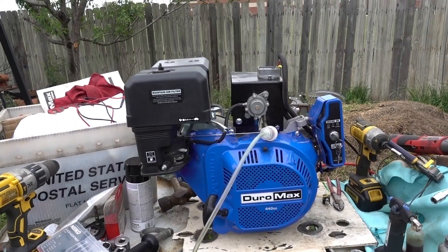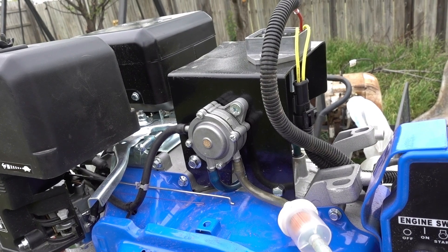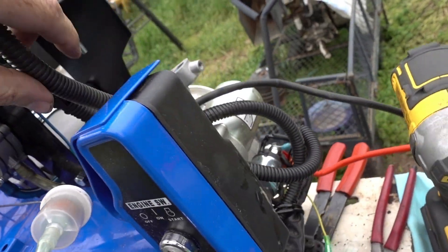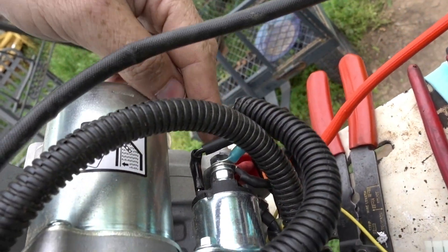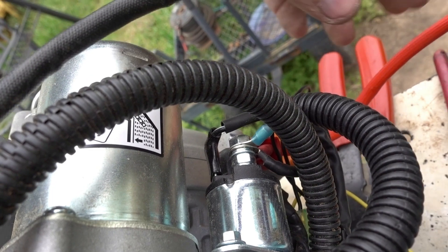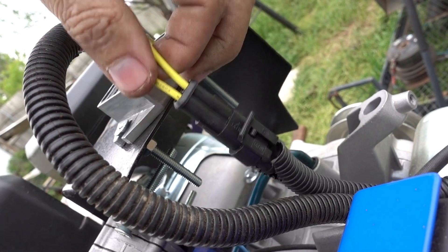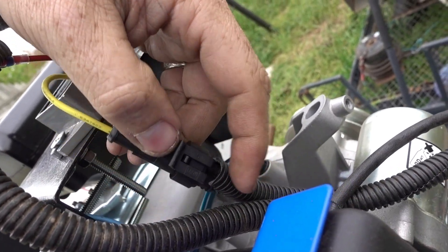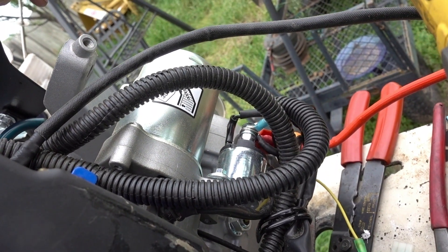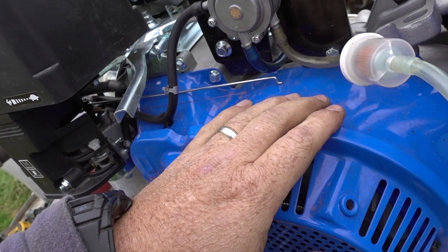Okay, so I kind of got everything buttoned up. I still want to put some more hoses on here — some newer hoses — but this I just snipped and soldered. This wire comes down around into this lug right here, so that's basically hooked up straight to the battery. This one here I put a connector on there so if I ever need to disconnect it for whatever reason I can just unplug that, and that goes to the two wires coming out from behind the flywheel.